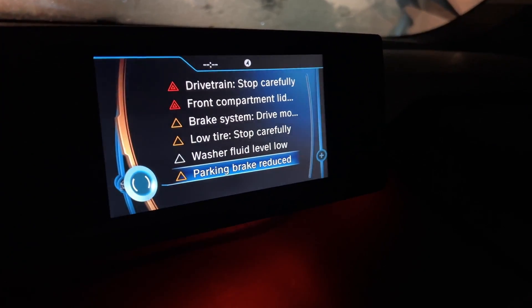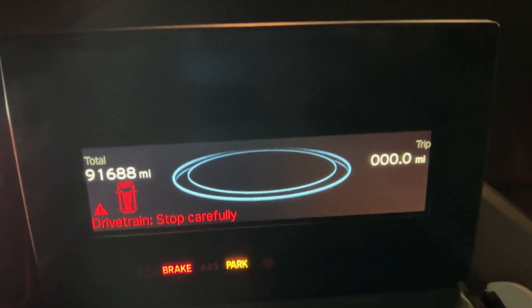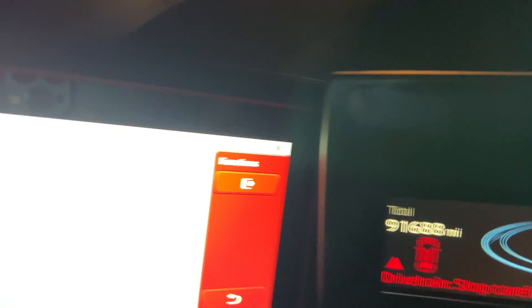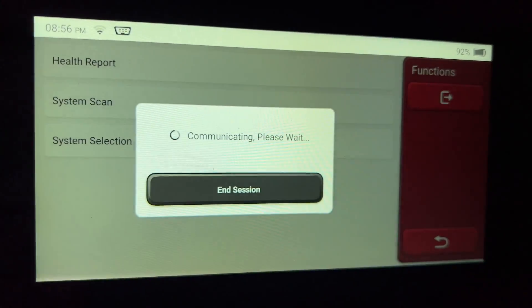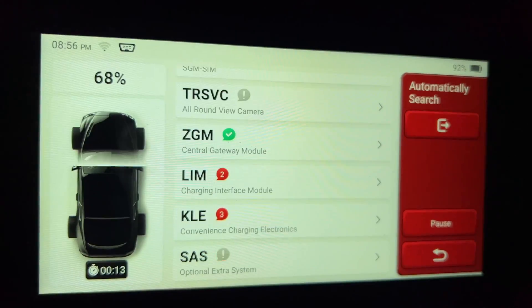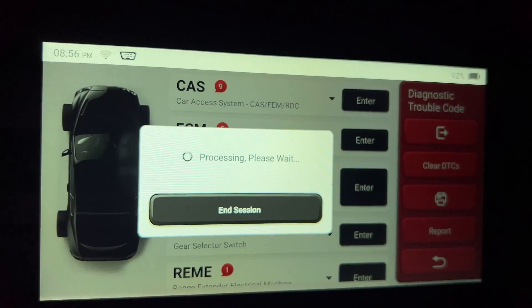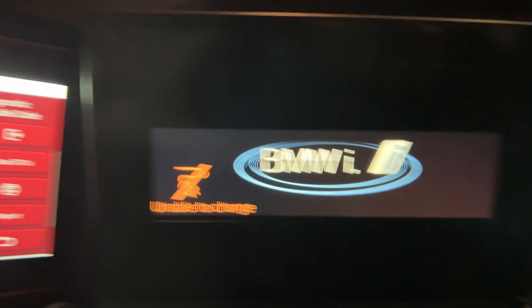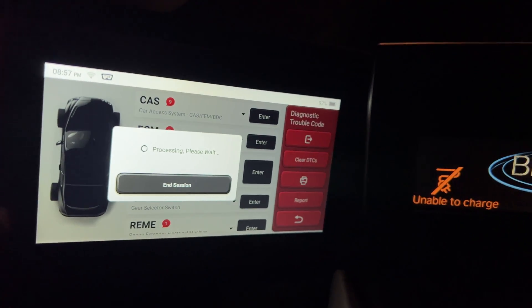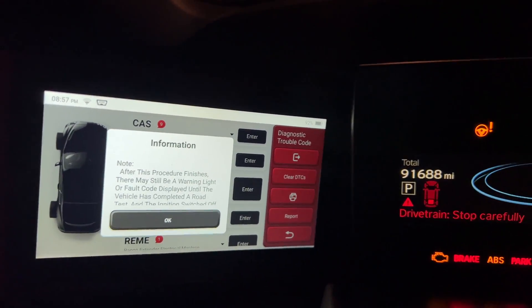Later that day, with the 12-volt battery in better condition, I was able to actually turn the ignition on. I was happy and excited, but immediately saw error messages on the center display and dozens of codes on my scanner. That wasn't very surprising as the car had just come back to life, so I erased all the codes and hoped for the best. Unfortunately, the codes that remained did not leave me with high hopes, especially after doing some research. What I had was the generic BMW drivetrain malfunction error message on the display and multiple high voltage codes.